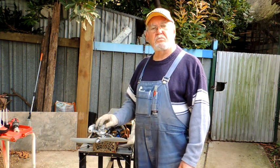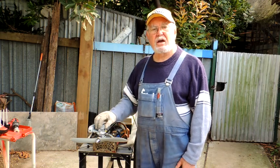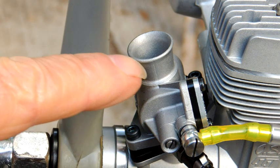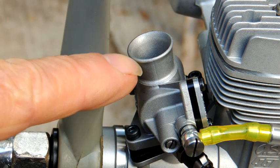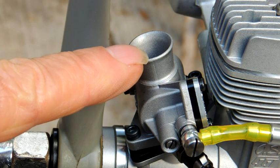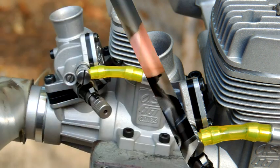Very small amount of fuel. I'm going to show you a few little points on it then we're going to start it up and see how it goes. Apart from the low compression, another reason why they're a little bit difficult to hand start is the very fine clearance between the carburetor and the propeller — when you're flicking down low you're going to strike that carburetor every time. Probably easiest and best to use the electric starter as they suggest.